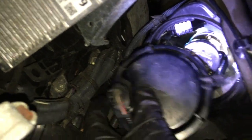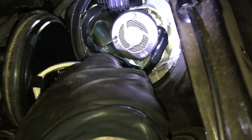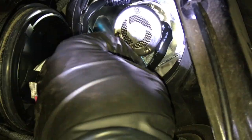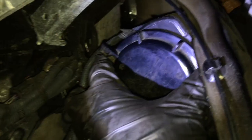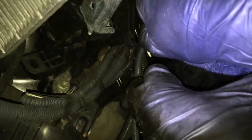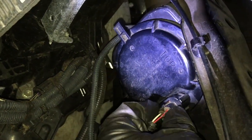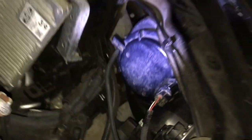Remember we have top and bottom. Make sure everything is inside nice and neat — all these wires. Then you close the cover. That's why we're using that specific LED style: you can close this cover without any modifications. See, it's in like it was factory.